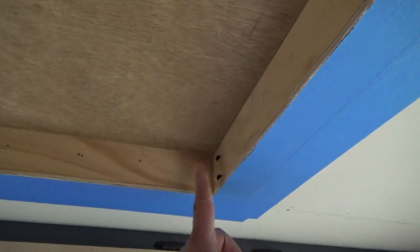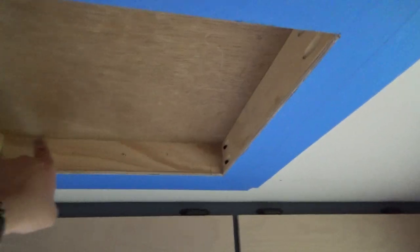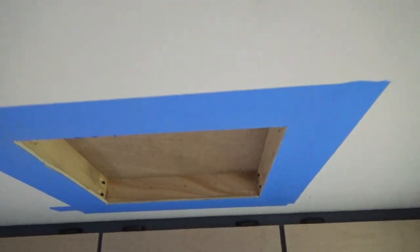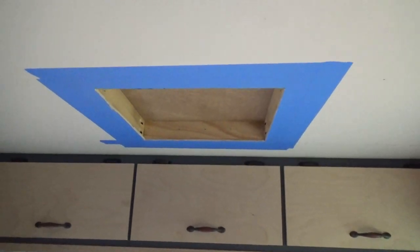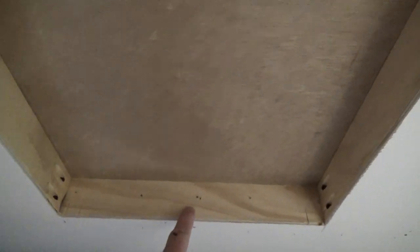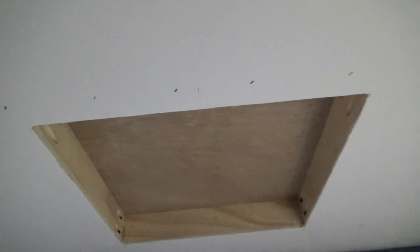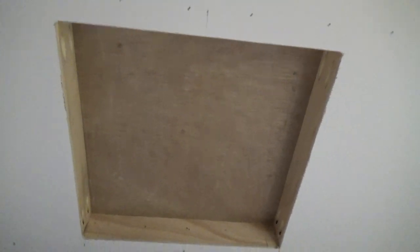What I'll do is take a drill bit on each corner and drill through the roof. Then when we get on top of the roof we'll connect the dots, trim our rubber roofing, take a router to trim that out nice and pretty, and then we can drop our fan in. So it's knock a hole for the wiring and then punch a hole for the vent in the ceiling. We'll see what tomorrow brings — I think it's supposed to rain but if I can get up early enough we might be able to install this thing. Everything is looking really good.